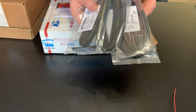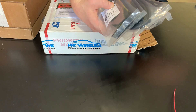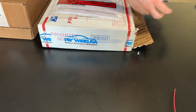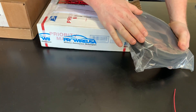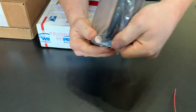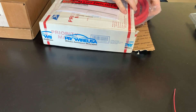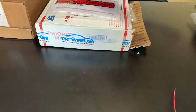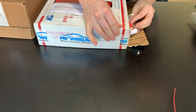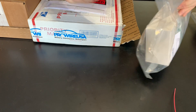These are all your standard Raychem DR25 heat shrink sleeving in various sizes — there's quite a lot of stuff in this harness. I'm also doing some battery cabling in this car, so this is some super nice heavy-duty battery cable. You can see it has dual-wall insulation and a ton of fine braids. I've got red and black for power and ground — gotta do what you gotta do.